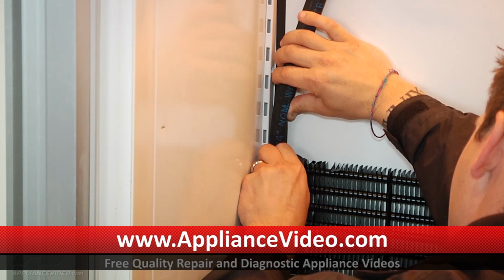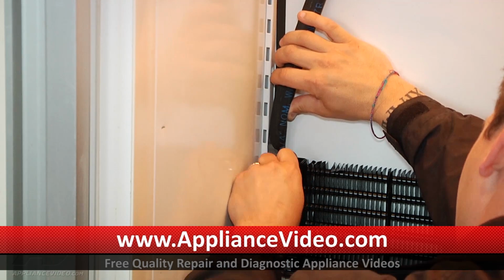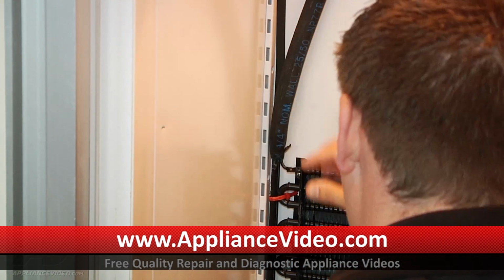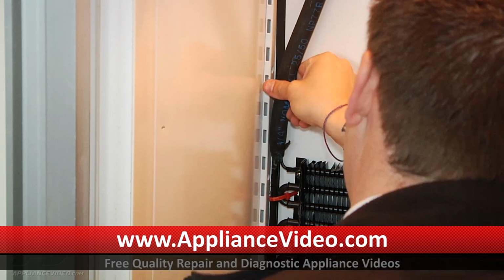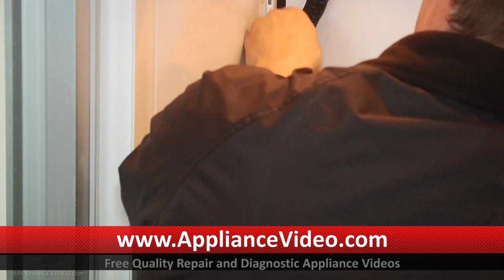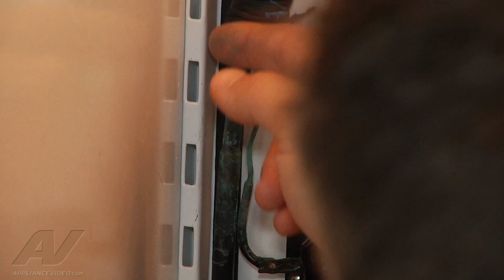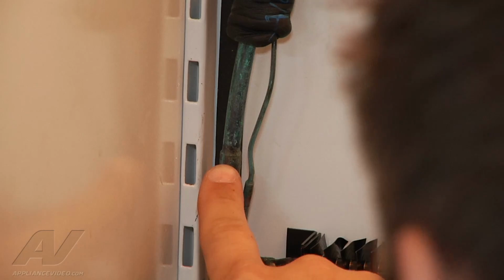So I just go ahead and just rip that tape off there, and then now we can. Okay, so I just got this styrofoam stuff up, which has exposed our two lines. We have a connection here that we're going to unbraze, and a connection here, so that way we get our new evaporator, we can connect from there.